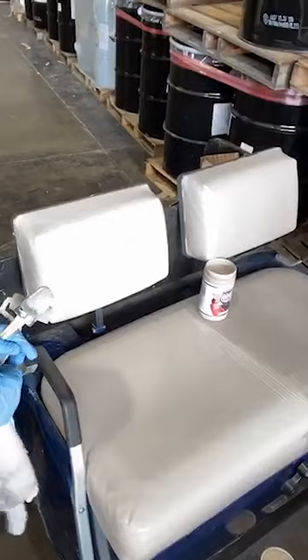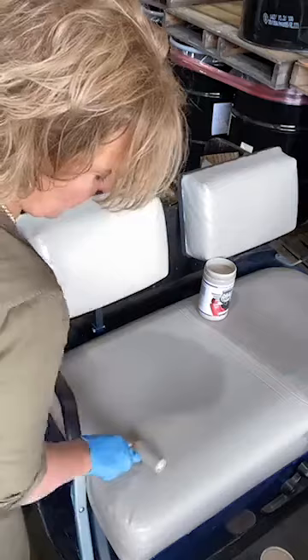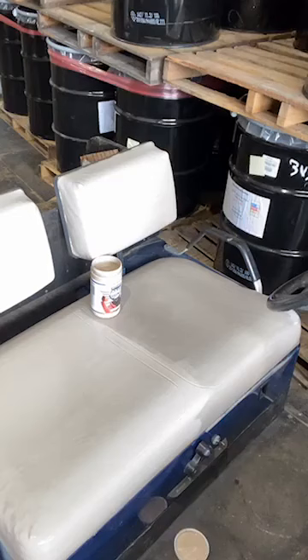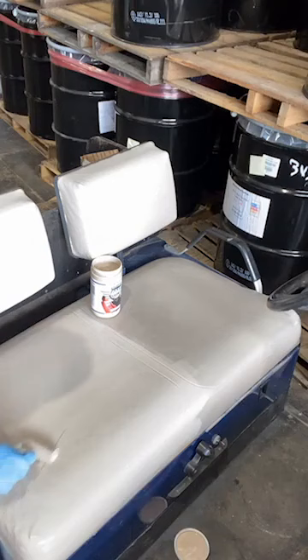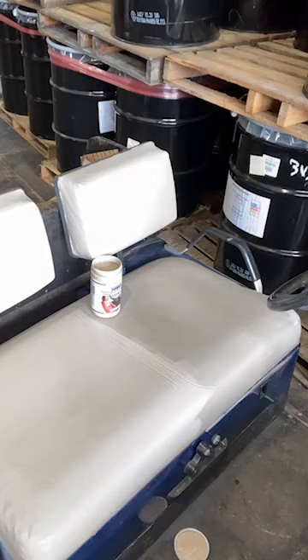So this side now has two coats and that side has one coat. The dry time on Bond & Flex needs to be good before you sand it — you don't want it to roll up. Depending on the depth, like that couch arm that was fully chewed, it took two to three days to dry inside. You can tell it's still wet if it's cold to the touch. Topically it may be sandable sooner, but don't paint over it while it's still holding moisture — let it all wick out.